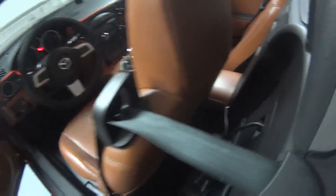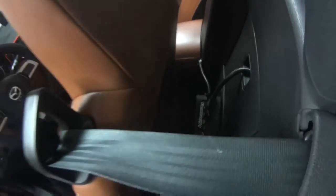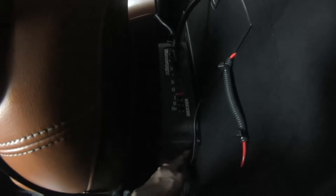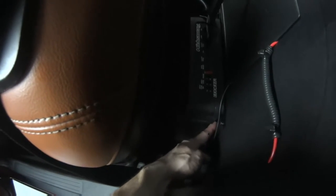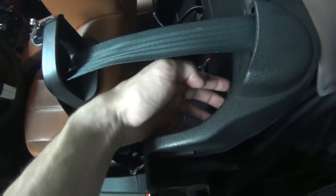There is a lot of cable, so I did hide it behind here and then just cover it up with this cable hider. One thing I noticed is there was like the smallest bit of rattle, but that drives me crazy. So what I did is I used some sound dampening material right behind the subwoofer right here, and also underneath this plastic. I also put some up here on this side, underneath this piece of trim because this flaps.